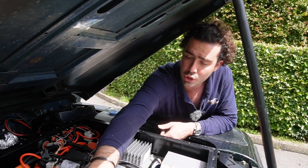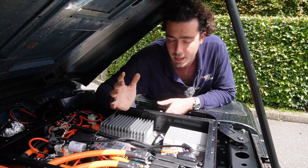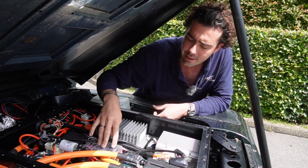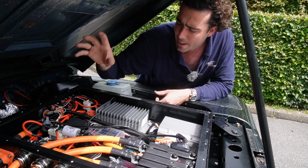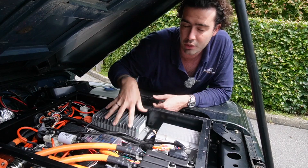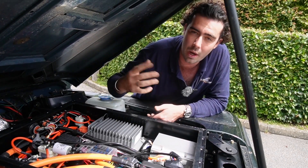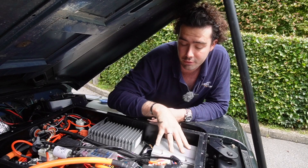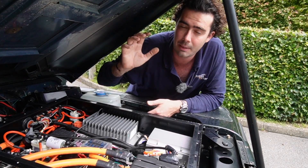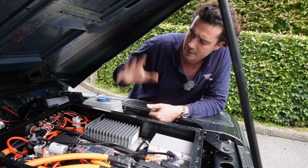In here you've also got water cooling — you can see water coming in and out of the box. That's just to keep the inverter cool because it's running at 144 volts nominal at 500, 600, 700 amps depending on how hard you're driving it. We've got a couple of 12-volt things like ignition, charge power, and constant power powering various circuits in the car. We've got the DC-DC converter, which converts 144 volts into 12 volts to charge up your 12-volt battery and run your wipers, headlights, things like that. And then you've got the BMS, which is the most important thing of the whole build — a very expensive box with lots of very expensive wiring, and that's what's keeping control of temperature, amp draw, voltages, making sure the car is safe at all times when charging and discharging.